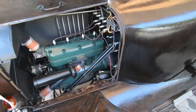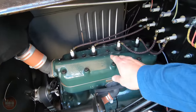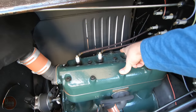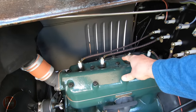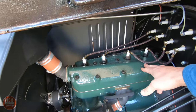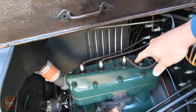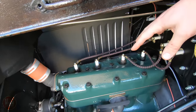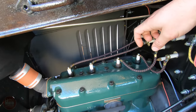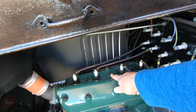It is running good, but I have had an issue come up since then. You may remember that I had to drill out a few broken head bolts — this one was broken and this one was broken, maybe one over here too. After I ran it for a little while, I went to re-torque the bolts. I had them torqued at like 35 pounds initially because I was concerned about stripping them. I've heard that at most you go up to maybe 50 pounds, but a lot of people do like 40 to 45 pounds of torque. When I re-torqued them at 40 pounds, this bolt stripped, which I was concerned about.